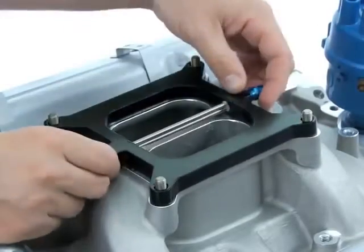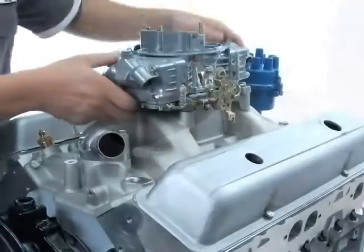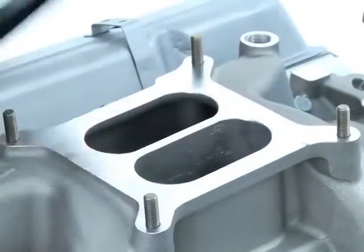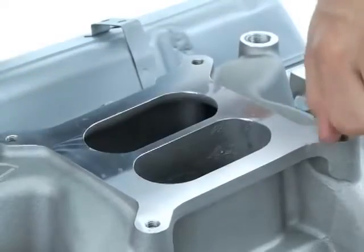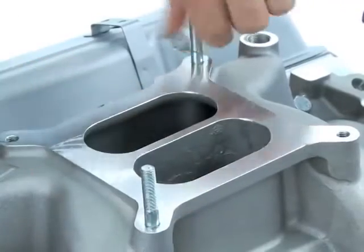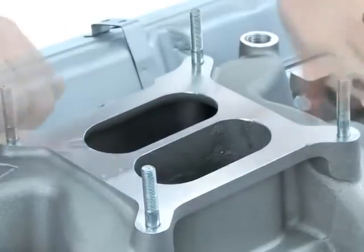and now pull the plate and be sure that the plenum or throttle body mounting surface is clean. The addition of a nitrous injector plate will increase the height of the assembly, so the stock bolts or mounting studs will be too short. In your kit, you should have a set of longer fasteners that will allow for the increased install protrusion when everything is put back together. Thread these new fasteners into place and find the gaskets that were included in your kit as well.